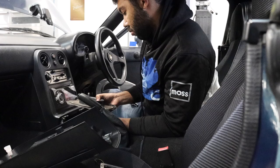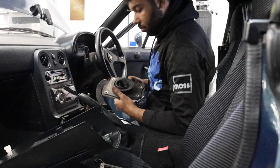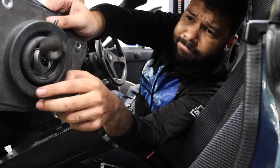I did also replace the shift boots and replace the oil in the shifter turret, but to be honest the footage I got wasn't very usable, so I decided not to use it. What I can tell you is that both shift boots were pretty ruined, so I'm glad that I preemptively bought the shift boot kit from MX-5 Parts, and I can confirm the gear changes better now the new oil has been put into the shifter turret.